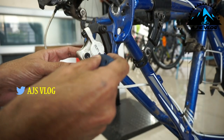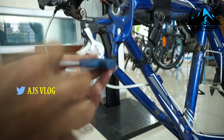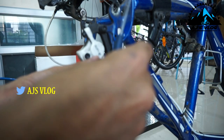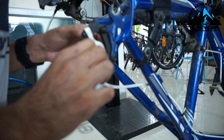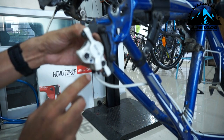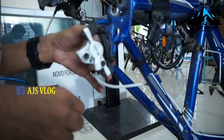Locate the small nut which is holding your brake pads in place. If it is a mechanical disc brake, there will be a pin holding it in place instead. After that, using your fingers in the gap, push the pads out. Don't forget to take out the spring too.